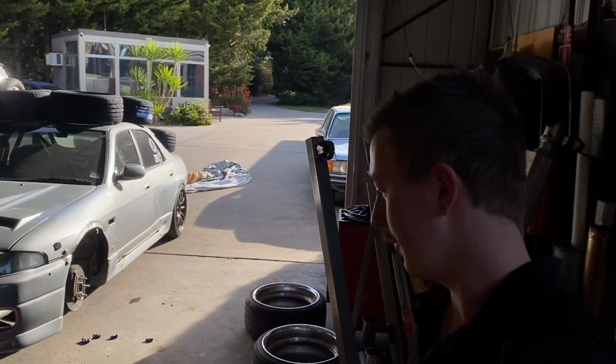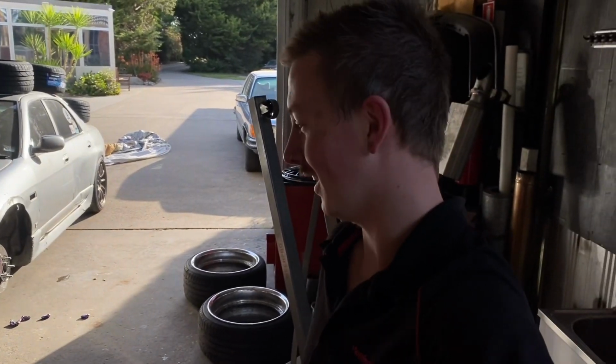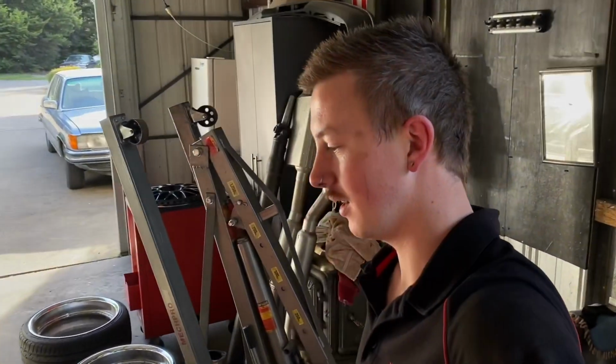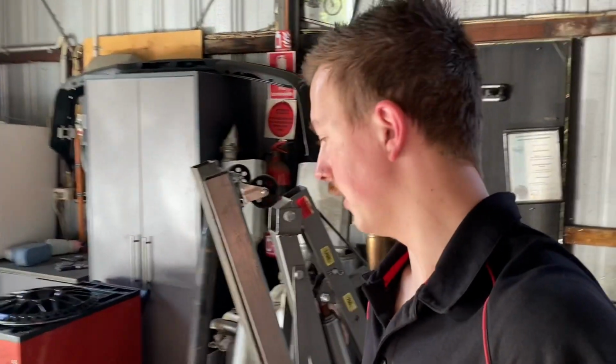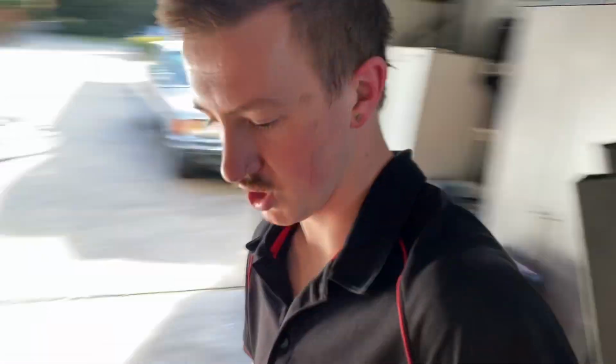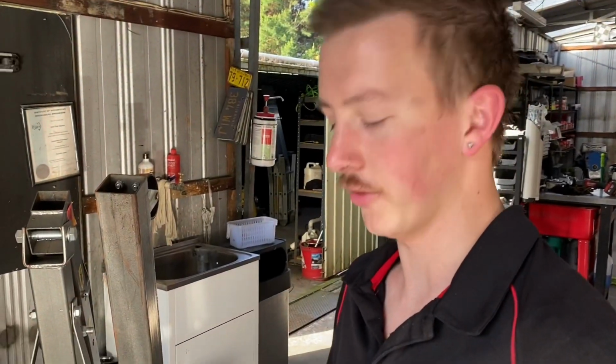Apart. This is my first time ever attempting to pull three-piece wheels apart, and it was not easy. I actually stripped the first bolt I'd done. So basically, I think it depends on the wheels, but the nut on the front of the face is a 5/16, and it's a 10mm on the back. Make sure it's a six-sided socket, because I didn't use a six-sided socket and I stripped it.